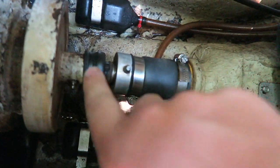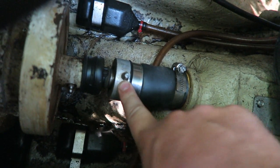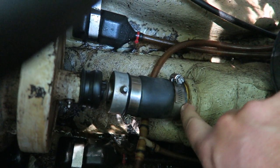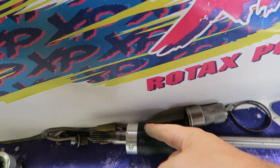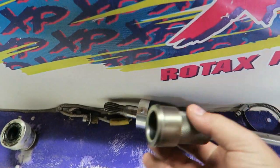That is what it's supposed to look like — the shaft comes through here and connects to the motor. This bearing is only held by this rubber hose, and it clamps here and here. The one inside was leaking water really bad, to the point where it was basically sinking. Here's the shaft sitting on the footwell — I've already got it taken apart, but basically this bearing was just spinning. It's not supposed to spin; this rubber piece is supposed to hold it.